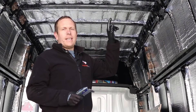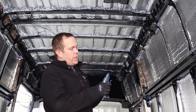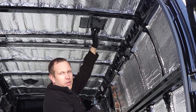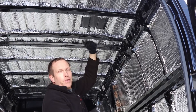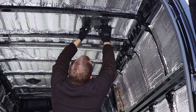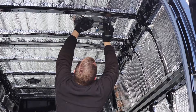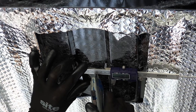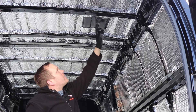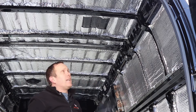Now I've got the lining taken away and I've got the bare roof. I now need to find the center of the rib that I'm going to drill. I'm going to use a set of verniers, or you can use a tape measure. Remember, looking from the inside, you want the rib that's pointing away from you — the highest rib — because on the top that's going to be the highest rib too. You don't want to be on these lower parts. I'm going to measure between these two points — we're looking at 70mm between those two, so I want to find around about 35mm. Just going to make a small mark on there. Now I know that mark is the center, because we're going to be drilling a big 60mm hole in there. If it's not centered it's going to come over the rib, you're never going to seal it, and rain's going to leak in.